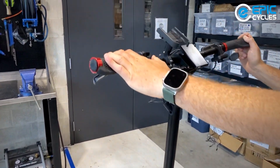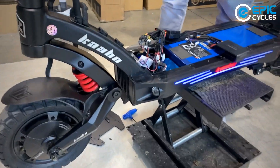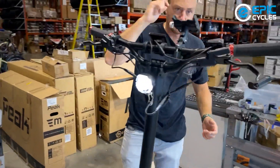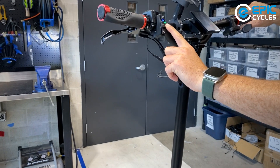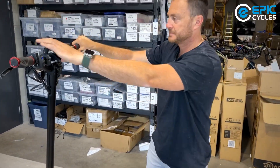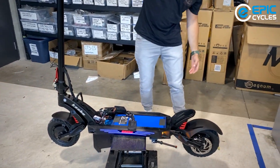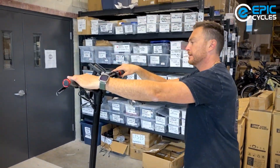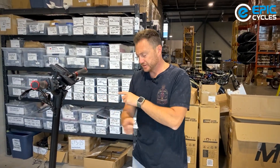The scooter does power up and we do have light. Let's try the left signal — and I got a right signal going on. Like I said, we mixed something up, so we're going to have to make a change there. I got left signal but the right one's going. Let's check the right — and we got the left signal going. So as I said, it's sometimes a little trial and error. Let's see if the horn works — our horn's working. Brake lights are working. All our signals are working. Front light's working. So everything's right except for we mixed up the signals — we've got to change two wires.